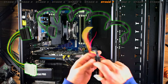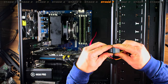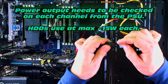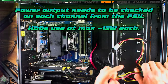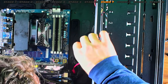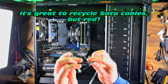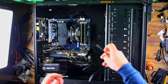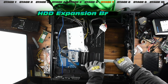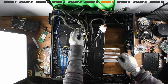We need power adapters — right now I've got a couple which will hopefully allow me to run at least four hard drives, but eventually we will expand. Definitely need some extension cables. Take note: hard drives use at maximum about 15 watts each, so keep that in mind as you're powering these so you don't overload your power supply rails. Definitely an upgrade on the SATA cables here — to something a bit more aesthetic than the red ones. Nothing wrong with pinching from previous machines, but let's go for something new.